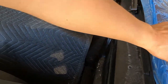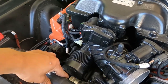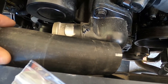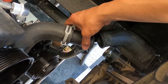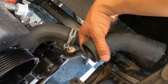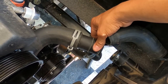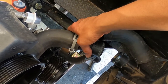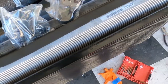We do have to figure out the hoses. The top hose should be pretty easy — you guys can see it'll land basically right there, I'm just going to cut it down a little bit since it's a little long. The bottom hose — you guys can see kind of where it lands — we're going to have to figure that out. Maybe we can just cut this guy here, but the angle's kind of odd. We might just need a straight piece right there; I might just go get a silicone boot and call it good. I think these might be two different diameters though, so I'll have to measure them. But the cooling system is coming along.